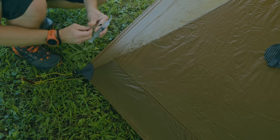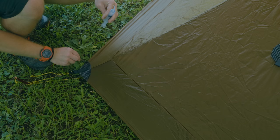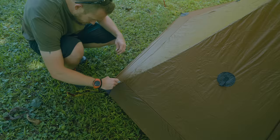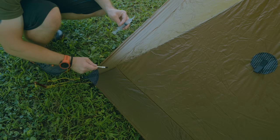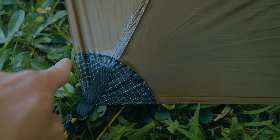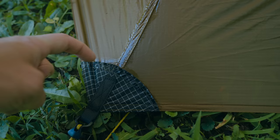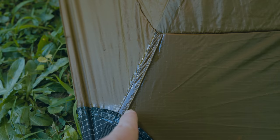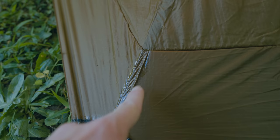I'm switching over to the acid brush and covering up all of that thread. Now I'm going up a little bit higher, switching over to the brush. Focusing on what I just did here — you can see the stitching on the outside, there are two lines. I went across those, used the brush, smoothed it out. Also, there's a flap that goes around here; I seam sealed underneath that and used the brush to fan it out. The same applies for this seam here — you have two lines of stitching, coated it, then this crease where the material is folded under and sewn. I seam sealed underneath that, used the brush, fanned it out.